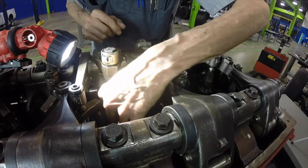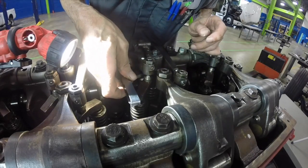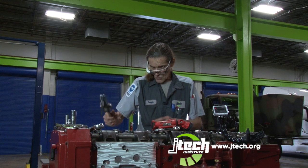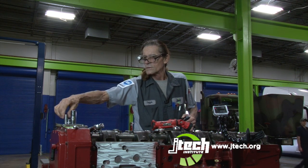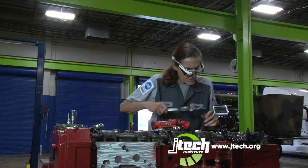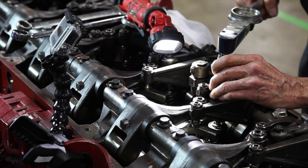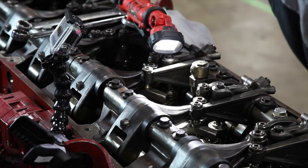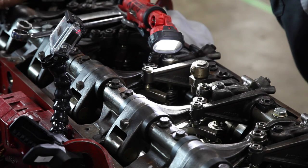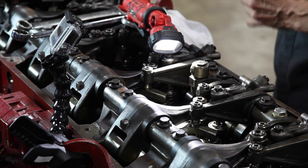I'll have to torque it at 177 inch-pounds. Feel this out. Okay, it has the right amount of clearance. Happy with that, 276 thousandths. Okay, now we torque that down to 171 inch-pounds. Okay, that's 171 inch-pounds, so that's got that one done. Now we're going to do our injector next. Set that right there. Mark. Okay, so that's got our Jake brake set.